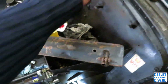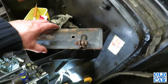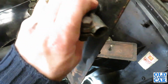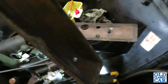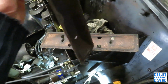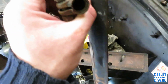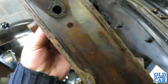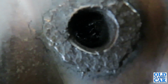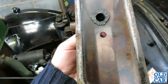That's the side cover off. These are the little wing nuts that hold it on. Underneath is the gasket. Now the hole for the breather doesn't line up with any hole on the gasket, but because this is concave and there are various circular gaps let into the gasket, that's what lets any fumes in the crankcase breathe out. And in theory they all come out of this little pipe here, and I can already see daylight just about through there, which tells me it's not very blocked, unfortunately.